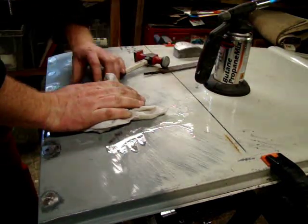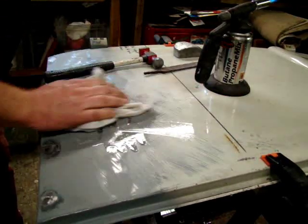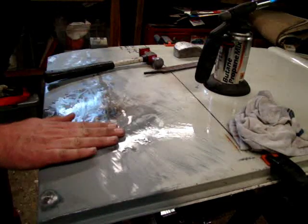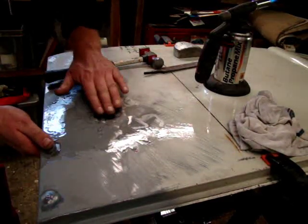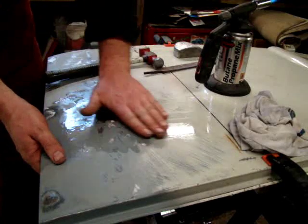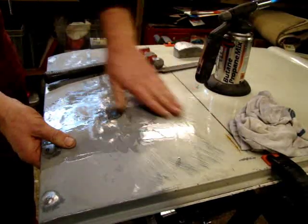Then with the block underneath, work onto the centre and bring it back down flat again. With the block quite firm pushing up underneath, as you hit the panel let the block spring away from underneath and then bring it back up again. Don't be too hard, otherwise you'll end up squashing the material — you just need to push the material back down rather than making it thin. You can see it takes a couple of attempts to get the area just right.